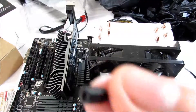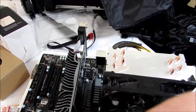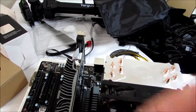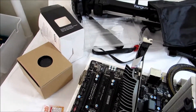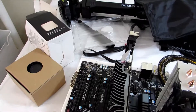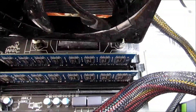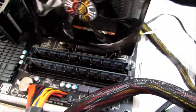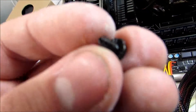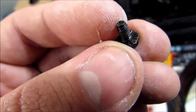Whenever you're ready to mount the motherboard into your system, you will find these risers — they have little holes in the top and threads on the bottom. You will thread these into the bottom of your case. The risers would be sitting underneath these holes right here. Then you would simply take your screws and screw them in as evenly patterned as possible. The motherboard screws usually have a grooved surface on the bottom to make sure they make good contact and do not fry the motherboard.